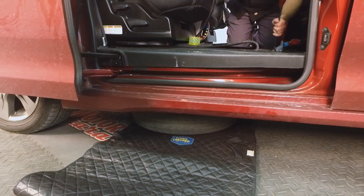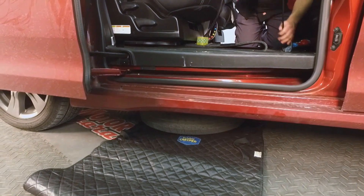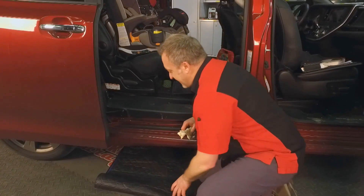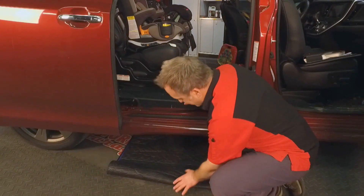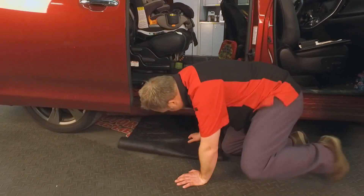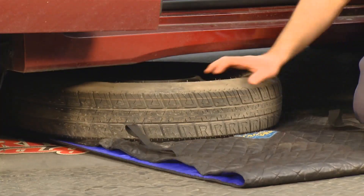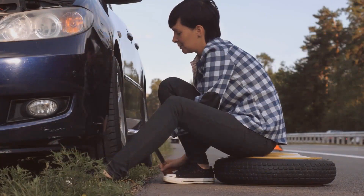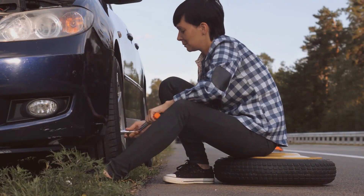And this is where the Magic Creeper comes in. That tire can be heavy — some of them are full-size spare tires; we have a donut in this case — but in either case they are heavy and awkward to move from underneath the car. So the Magic Creeper comes in handy. Once you get the tire lowered and down to the ground, you can use the Creeper as a conveyor belt. It's super easy — pull the tire out, unfasten the nut underneath, and you are on your way to putting on your spare tire.